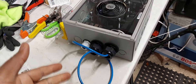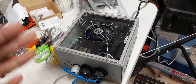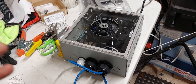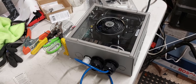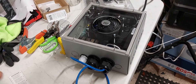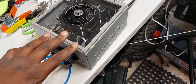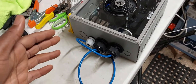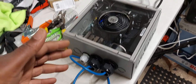That cable will be going to the first wireless access point. In this box I have the MikroTik — it's a four SFP port and one Ethernet port switch. The SFP ports can do different module types, including 10-gig copper or 10-gig fiber. I'm doing 10-gig fiber to this from my main switch in the house. The main reason I put this in an enclosure is that this MikroTik runs really hot, and the shed won't be climate controlled.